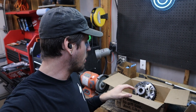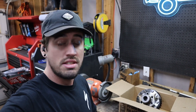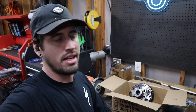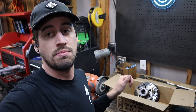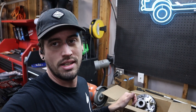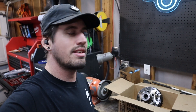Next steps: we need to figure out how to get this end of the axle shaft out of the carrier and see if the carrier is okay — that's really the biggest thing here. Bearings I think I have some around, and worst case they're 20 to 50 bucks. But if that axle shaft ruined the splines in the locker, that's a thousand-dollar mistake and a big deal. Let's see if I can get this thing out — that'll let me rest easy if it comes out and the carrier's not ruined.